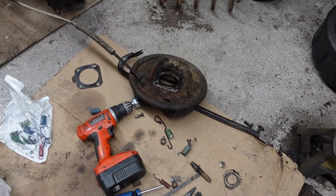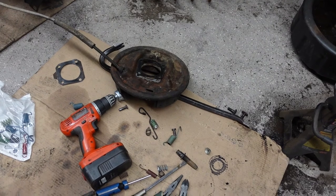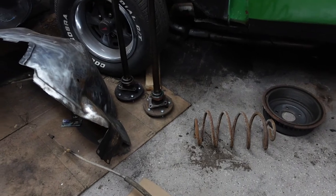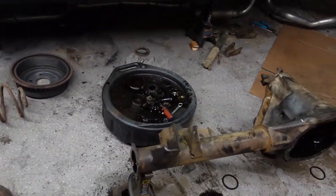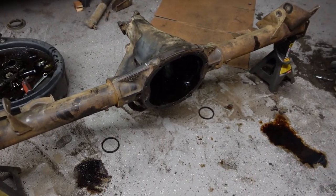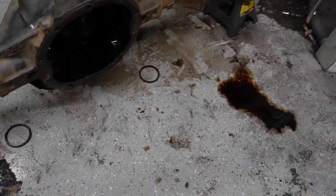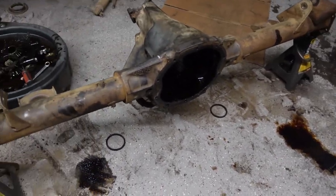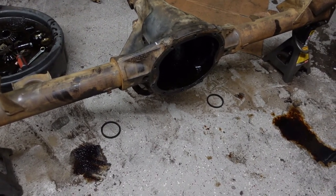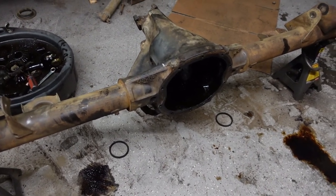There's the other drum. I should have the brakes done tomorrow, and then hopefully next week we can start putting some stuff back together. I'll get those bearings pulled off the axles, get that cleaned up, get them ready to go back in. I've got my carrier. There are my two shims laying on the floor — one on the left, one on the right. I measured those: they're within five thou of each other. So hopefully when the new carrier goes in it'll be similar, or we might have to play around with shims. I'm buying a rebuild kit, so it should have a bunch of shims in there if necessary.